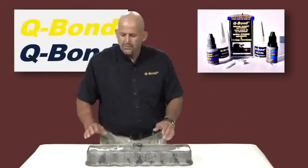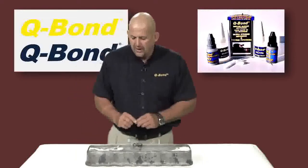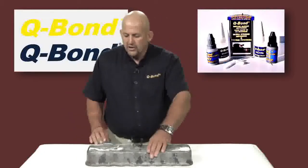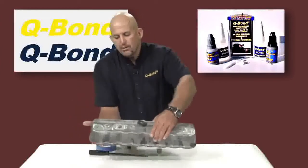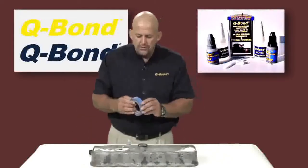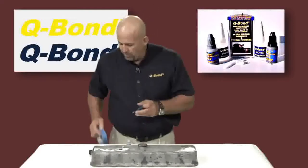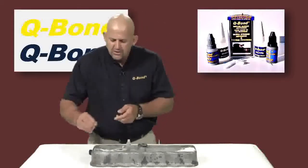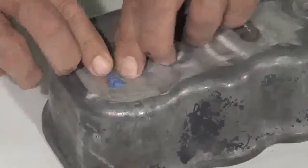The first item that we're going to repair is this tappet cover or valve cover. Now there's two ways of actually repairing it. If you have access to get behind a hole like this one, you can put some tape on the rear and then fill it up with the powder. If not, you can also use some of the same tape and plug that hole with this tape. It can be normal tape, it doesn't have to be a special kind of tape. It can be any material, just to seal the hole and prevent the powder from falling through. There we go.